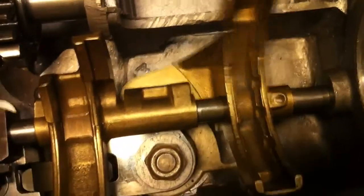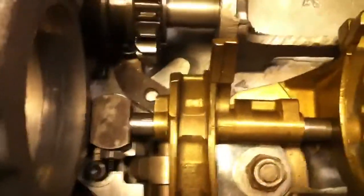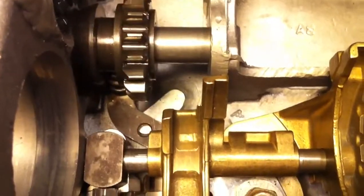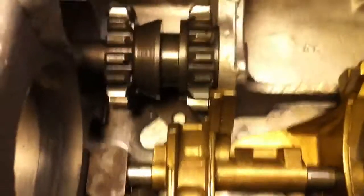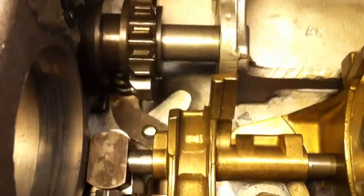3rd, 4th. And then through the 5th gear gate, let's go all the way down to reverse. See a nice smooth click. We took a lot of slop out of that lower fork by raising it up in the box, shimming below it, so that we have a really nice engagement here.